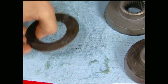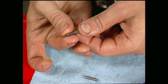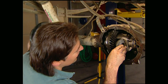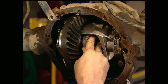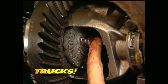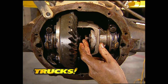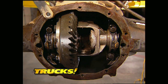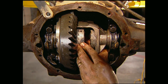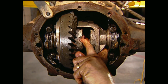Press a greased thrust washer on the back of each coupler, then insert the small spring into the large spring and add some grease to hold them together. Now we can install the washer and coupler assembly on the left side of the case. Slide it over the splines of the axle. Take a C-clip, put it in the groove, and pull the axle out to seat the C-clip — make sure you watch your fingers. Carefully push the other axle onto its coupler until the axle shaft is even with the coupler's surface. Take a driver spacer assembly, place it on the teeth of the coupler, then press it into the grease. Reach into the center and press the spacer down over the coupler's shoulder and over the C-clip.